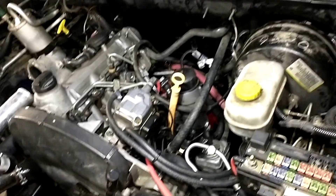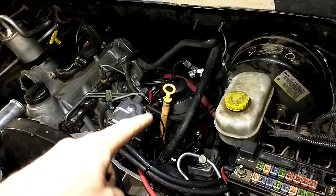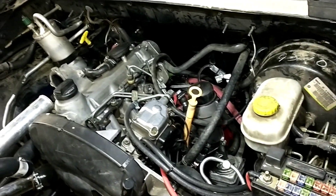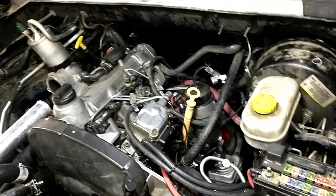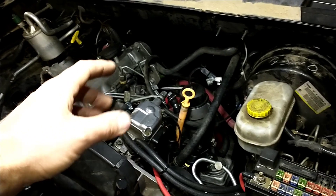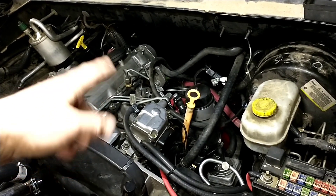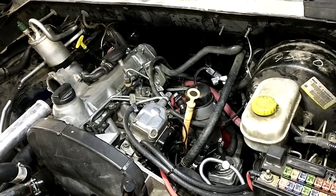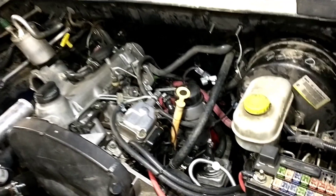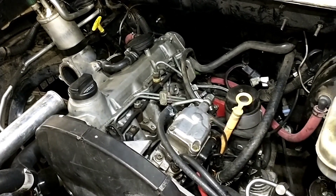My overview: I have no Volkswagen wiring in here at all yet, and all my sensors for my gauges are hooked up using the factory Dodge wiring - it'd be the same with any other vehicle. Just tape that up, clean it up, and then when I make my standalone harness it's so small - about the size of the fuel lines. You add that in and it doesn't have to be this whole tied-together electrical system. It's so easy to just leave them separate, and then you know what's what.